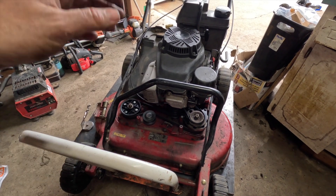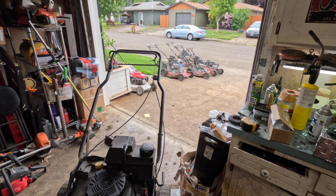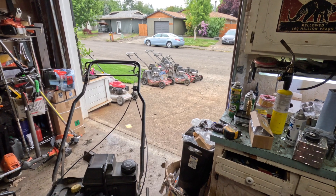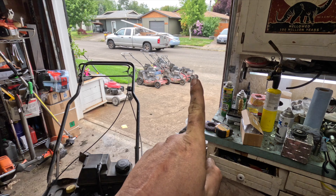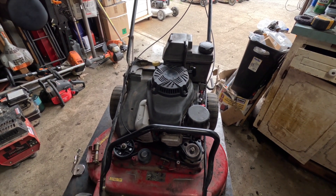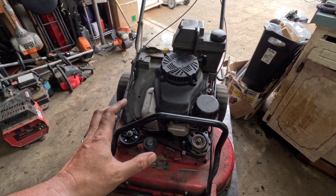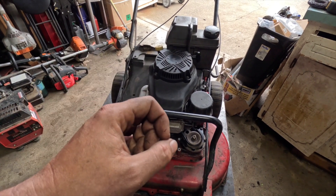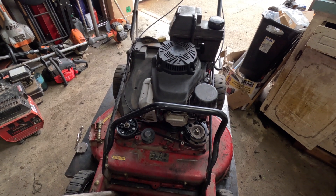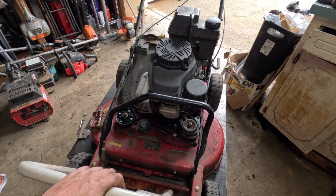Do not over-tighten your belts - you will see so much additional work and expense if you do. See all those mowers? They are all here for the exact same reason except for that 21-inch. The 21 actually has the exact same motor as this 30-inch. If you need more power you just need to buy a different, bigger machine - this mower is adequately powered as-is. You don't need to over-tighten your belt; if you do that you're going to have more downtime than uptime. Put a thumbs up if it helped, subscribe, and follow me on Instagram at Small Engine 101.